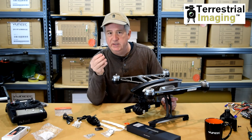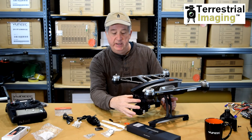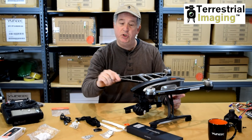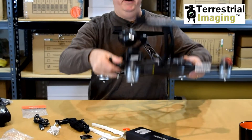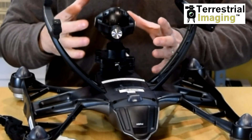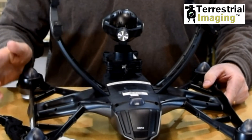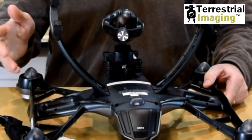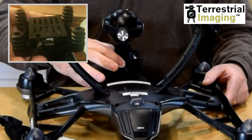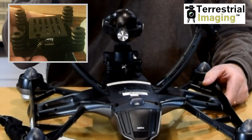The purpose of this is that in the event that you detach the bottom plate from the top plate on your gimbal camera, you have a way to basically jumper the actual camera back to the body of the plane and put it back together so that it works. So here's the scenario: you fly your Q500, you have an accident, you hit a tree, it falls to the ground, and the gimbal separates. The little rubber bushings that hold the gimbal together come out and the bottom plate separates from the top plate, and those three wires come out.